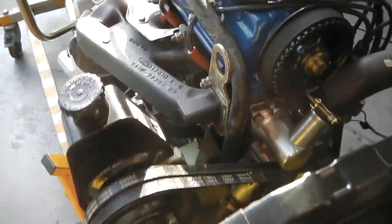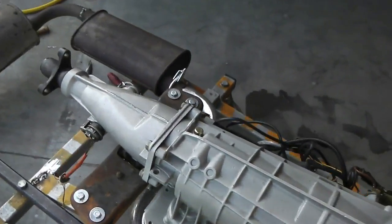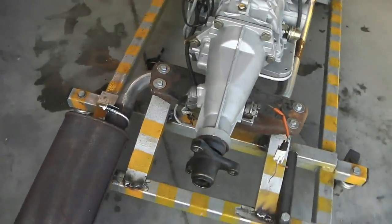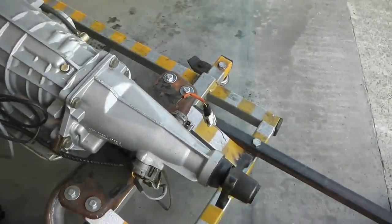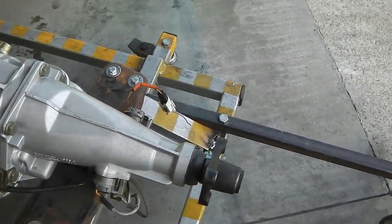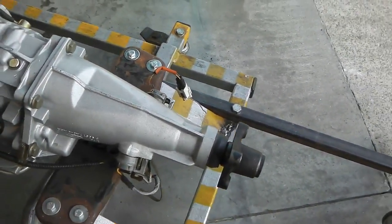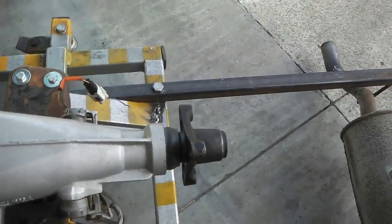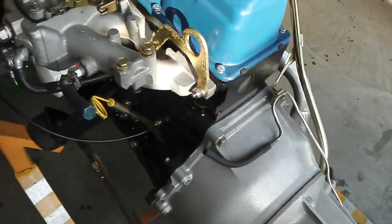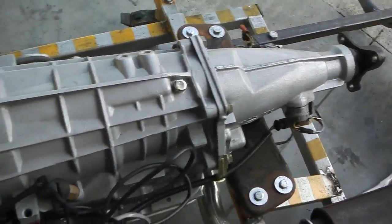So yeah, a lot of those tests are coming back good. Gearbox engaging and going in okay. Make sure when you do your gearbox, if you're freewheeling your box like I am, you've got to make sure when you put it into park that it is not still rotating. Normally the motion of the car would stop that from rotating, but it can free rotate and your pawl will jump on the gears at the back on the pawl catch. So be careful of that.